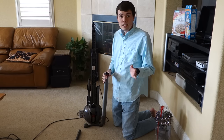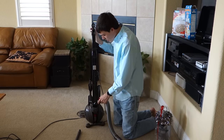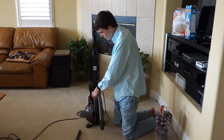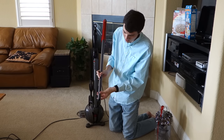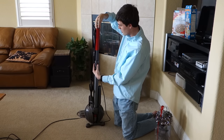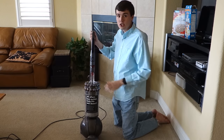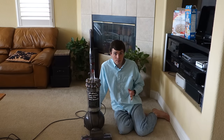If all of these steps have not solved your issue, you need to give Dyson a call. They can typically sort out problems very quickly and they're great about customer service. If you need to reassemble your vacuum, it's very simple: make sure the red tab points towards the front of the machine and push in until you hear a click. Put the hose upright. Take the wand with the notch face down and while pushing the red button, slide it in, then reattach the wand to the handle, close, and reattach the bin. This should have solved most of your Dyson problems and shown you how to do maintenance. This has been Logan here for VacBin.com. Thanks for watching.